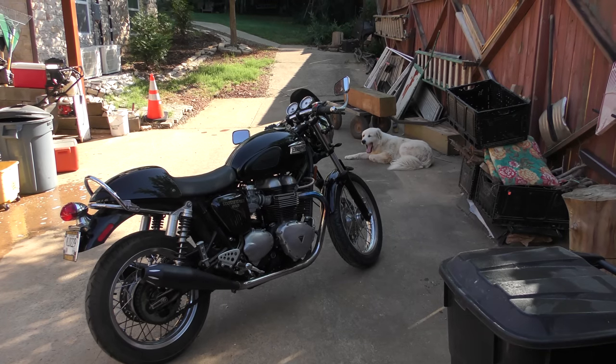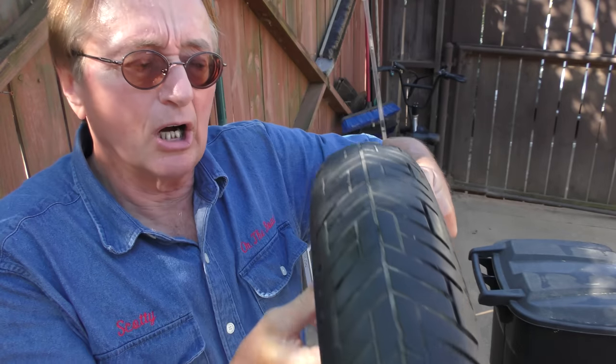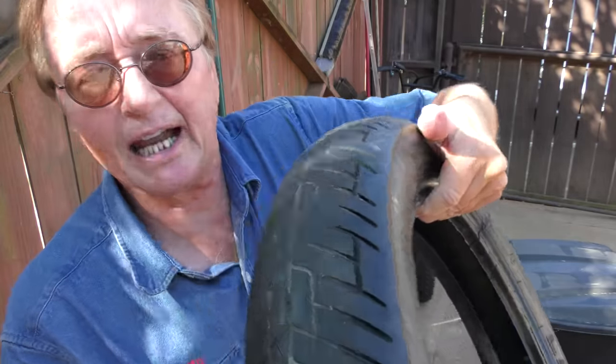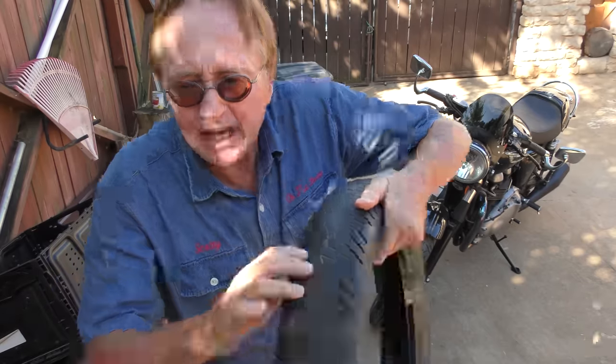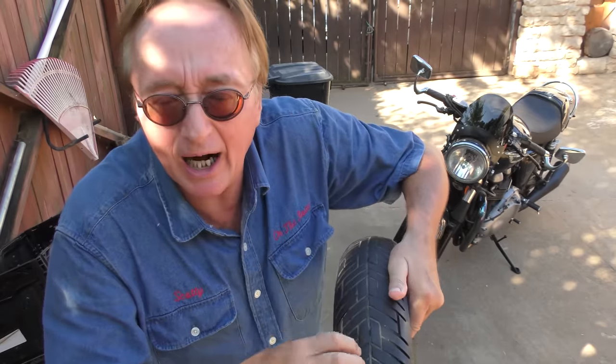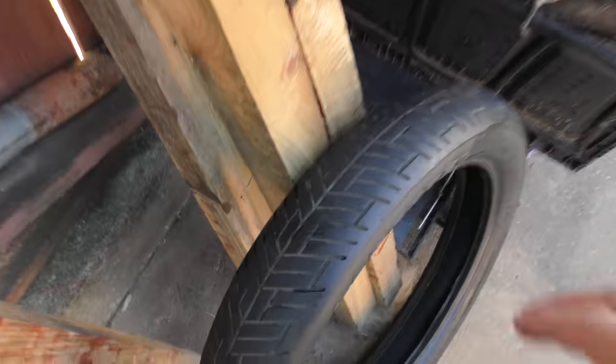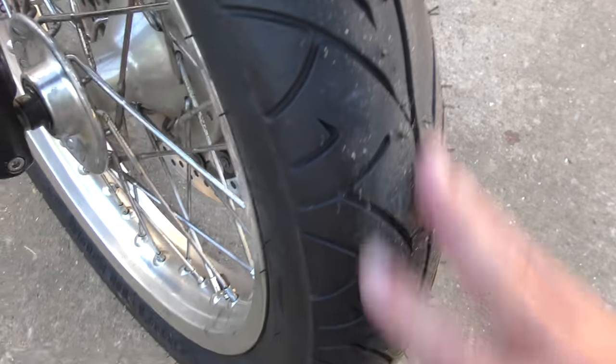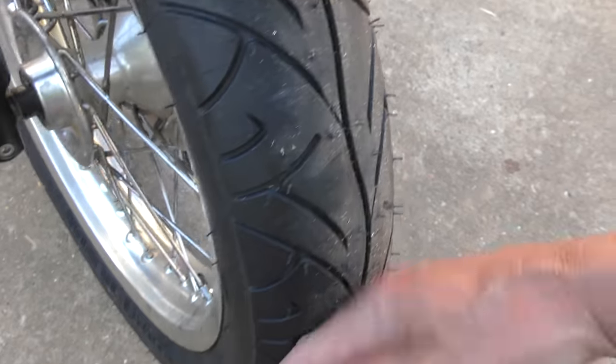The next thing is tires. Realize you're driving down the road on air and rubber. You might look at a tire and think, 'Oh it's got tread, it's a good tire.' But these are extremely unsafe motorcycle tires, because they're the original tires on this motorcycle and they're 12 years old. Yeah, they still have lots of tread, but as tires age they get too hard — when they get too hard they don't grip. You want a relatively soft tire on a car and especially on a motorcycle for any serious driving. When you look closely you can see cracks everywhere on the inside — it looks good from far away, but it's old. Now put these Italian Pirelli tires on — see the inside is clean and not cracked — these are nice racing tires.